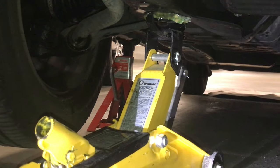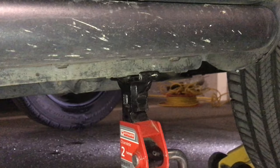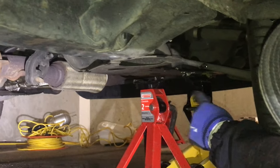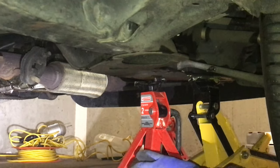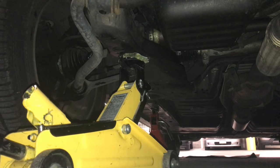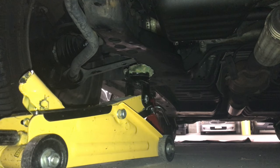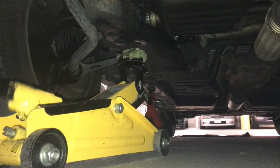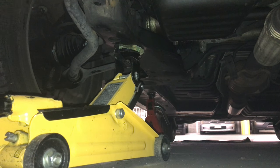I'll give you a closer shot — here is the unibody weld and the jack stand goes underneath there. Alternatively, you can place it along the same cradle where I lifted, just a little further on. It's a bit harder to reach than the weld, but it's another valid spot. I've positioned the jack stand where I need it, and I'm gently releasing the hydraulic jack pressure. You can see the jack stand is now holding the vehicle. As an added precaution, I'm keeping the hydraulic jack slightly taut underneath as a safety measure.